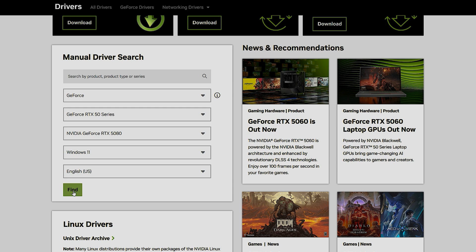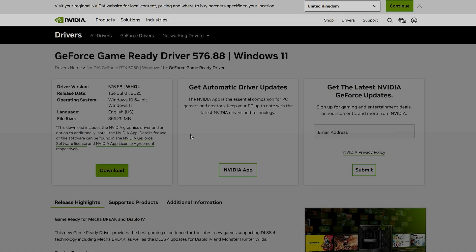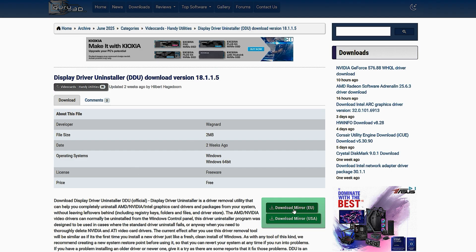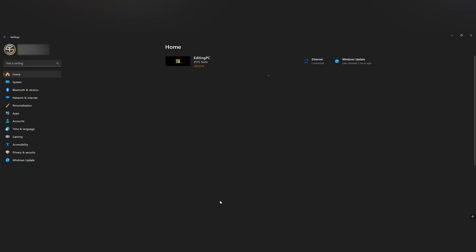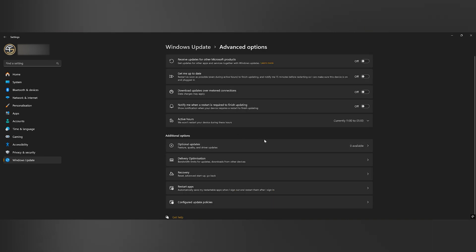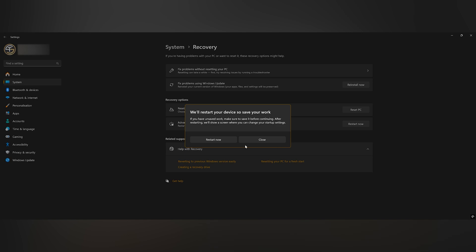Let's set this monster up for peak performance. First of all you will need to go and download the latest video drivers from Nvidia's website — a link will be in the description. If you're swapping out an old card, be sure to download Display Driver Uninstaller. After that has been installed, you need to boot into safe mode by going to Windows Settings, then Windows Update, Advanced Options, Recovery, then hit Advanced Startup. From there you can find safe mode and boot into Windows.